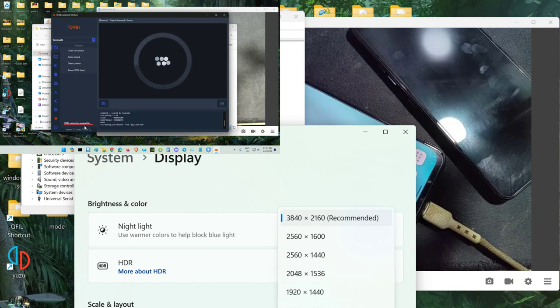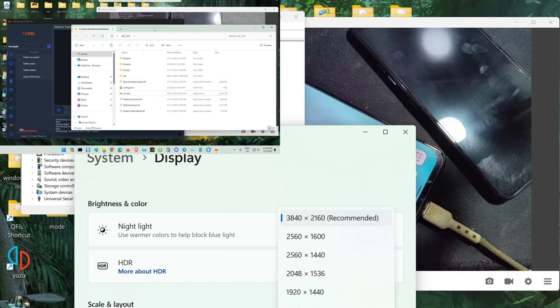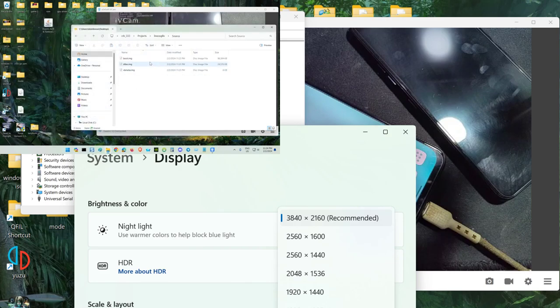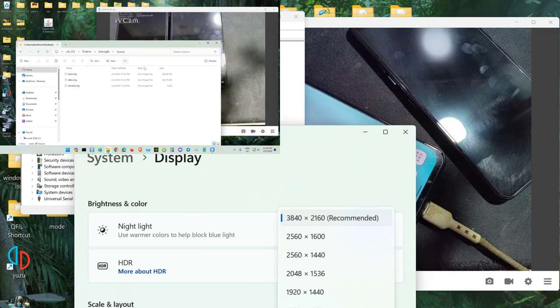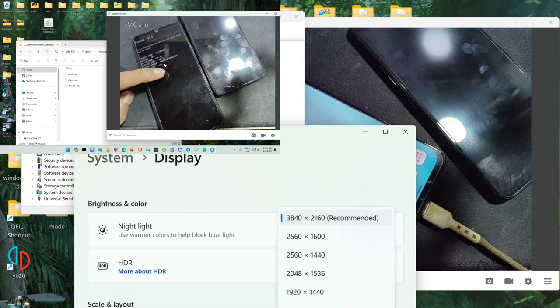This is another method. I don't need any custom recovery. I use the recovery inside the boot image of this LineageOS. Right, almost finished. Set the project LineageOS. It's done. So cross this one. I just need the boot image. This boot image. So my LG G8X, boot A, the active slot is A. My V50S is also A. That means it's easy for me to remember.